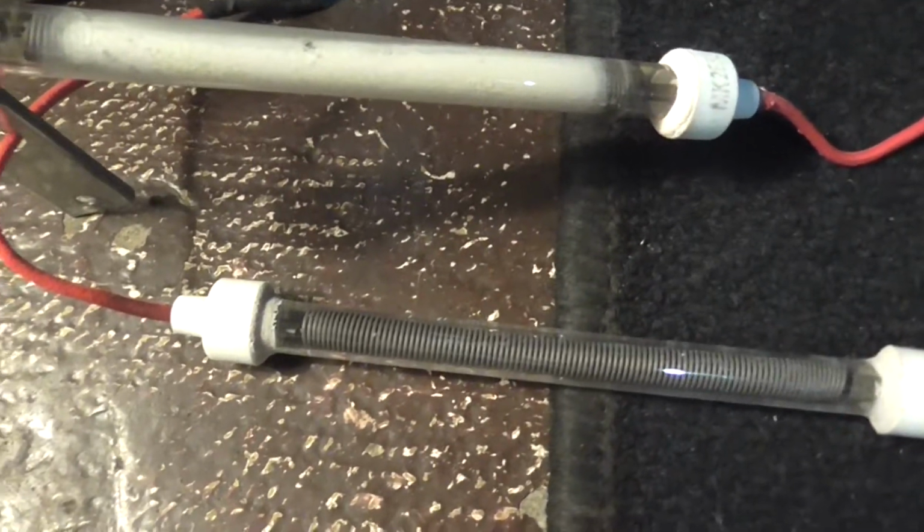And this is pretty much what I get with the Eden Pure heating system. I gotta stick that little wire back in that hole up there, crimp it back down, and it should glow red again. So that's what I'm about to do, is fix that beast. Another snapped element. That one looks like it's in pretty good shape.